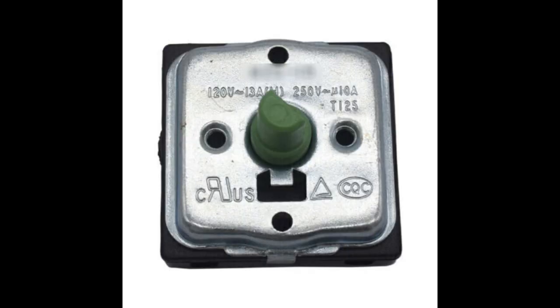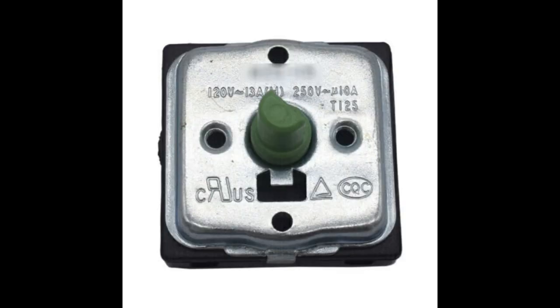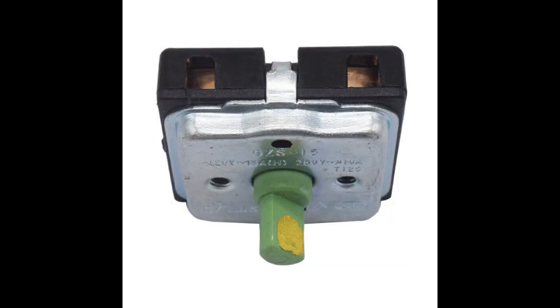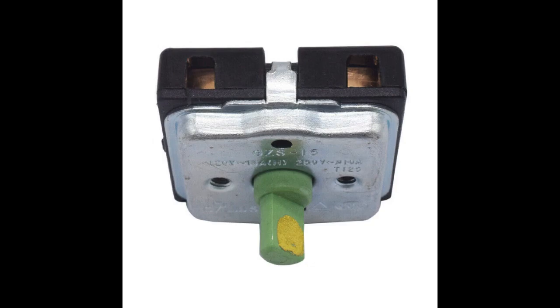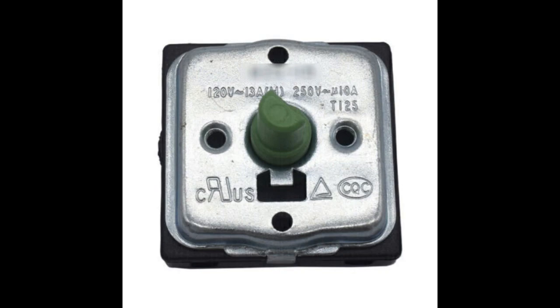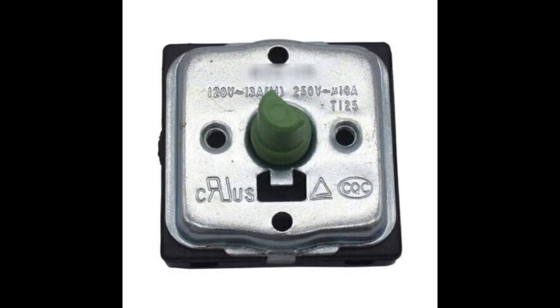So what happened to my switch, you can see a little square window on top with the copper. It's kind of like a spring holding the wire. So one of them was overheated and damaged, kind of. So what I did, I switched the copper spring from the purple wire to the wire going to the bulb. The bulb wire has very low current and it doesn't need a lot of connection there. So everything works fine so far.